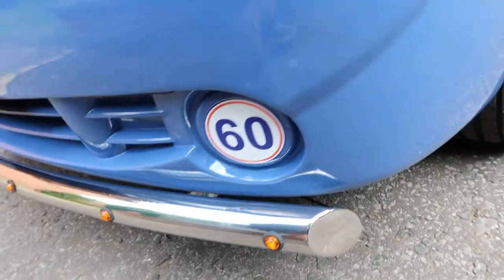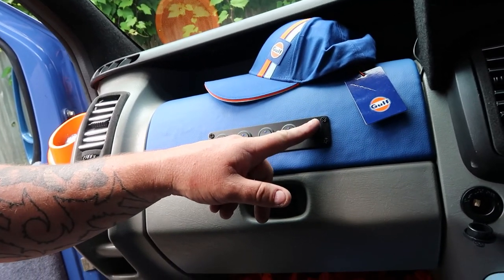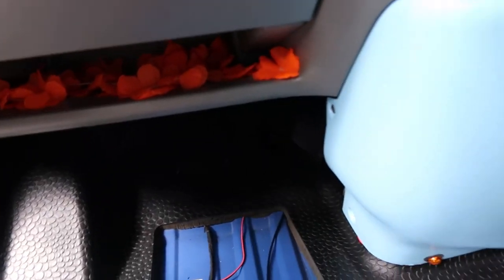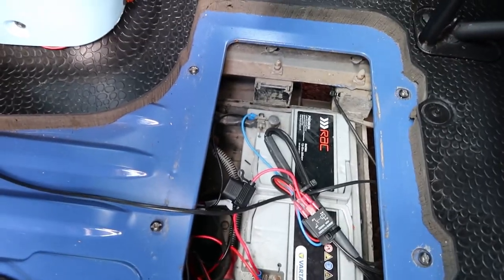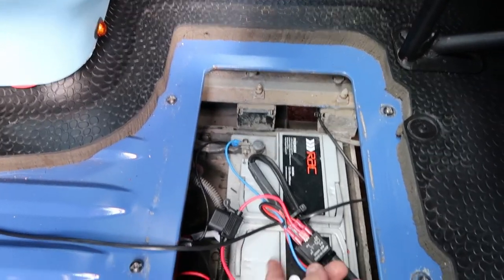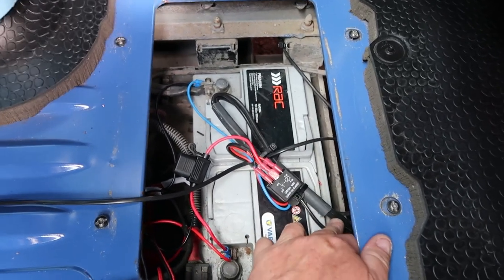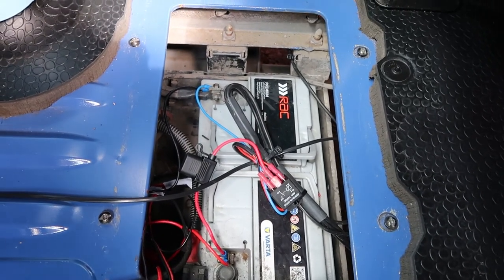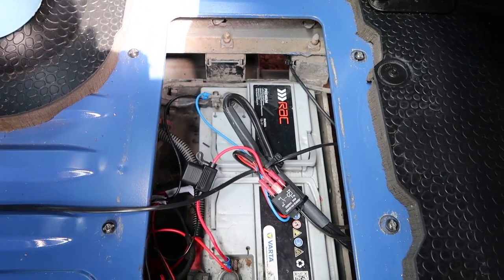And the front. Right, so the lights are powered by a switch panel, which was already installed on the dash, and it was running off of that switch there. Now, we did already have the wires hanging down for the switch. So the switch has gone into this relay here. And if you look at all these cables coming up, just here and here, there's four of them. Two bars at the back are wired together with one wire coming forward, and each one of those cables represents a bar on each side in the front.